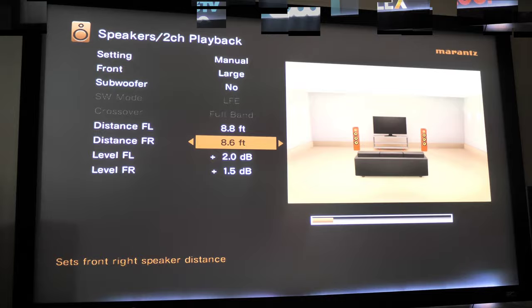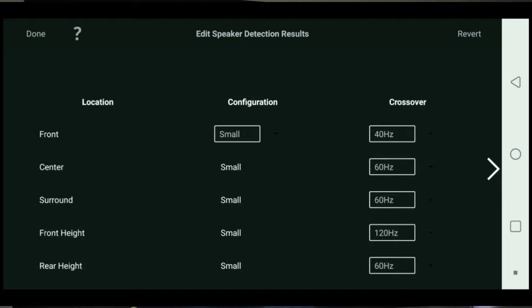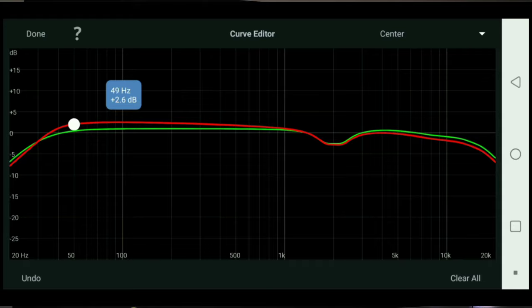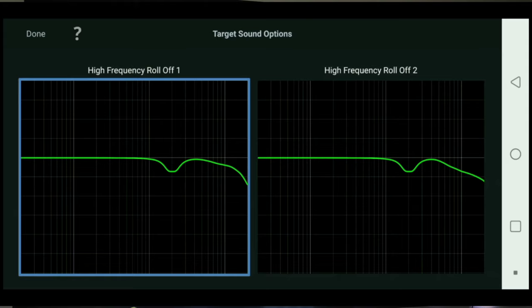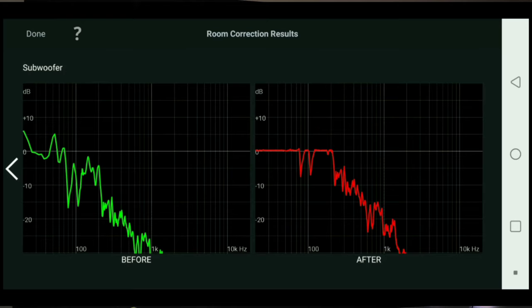We've officially gone back behind Audyssey and corrected its mistakes. If you don't have the Audyssey app, I recommend getting it — it's twenty dollars and lets you fine-tune your frequency response curve. For example, if you have an 80 Hz peak you can lower it, or a 45 Hz null you can boost it. You can also use a third-party app like REW. I've made videos on the Audyssey app for Denon and Marantz — I'll link those in the description.